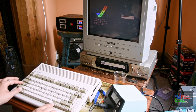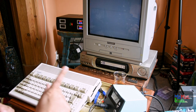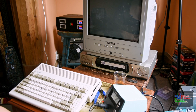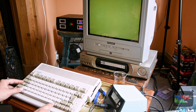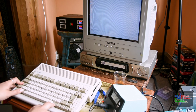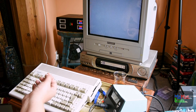So how you change the kickstart is you hold and keep reset. Let's go through them — there are a few ROMs on here. That's the first beep — that'll be 2.0. Two beeps, that's the second ROM. That one doesn't seem to work, or doesn't seem to like it — maybe it's because of the Furia. That's 1.2, so that's the third one. 1.3 — that's the fourth one. And 3.1 — okay, so there are four, but the 1.2 doesn't seem to work.